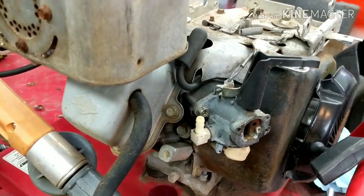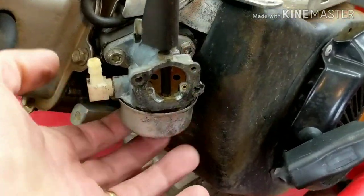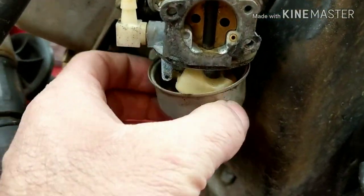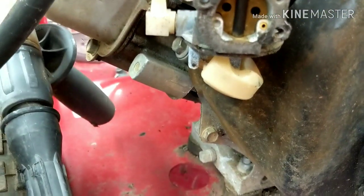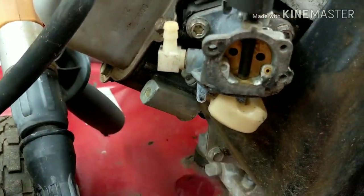What's happening is your bowl is not filling up completely with fuel. So here on this pressure washer, the bowl goes on right here. And when you take this off, you'll have your bowl underneath it. There's just a bowl, it's a jet on the bottom — you need to make sure that it's clear. This comes out of the bottom and the bowl comes off.